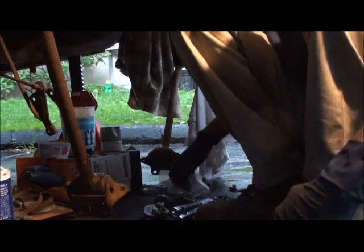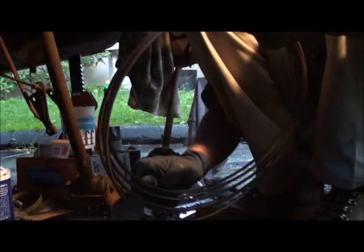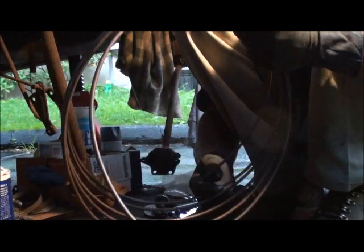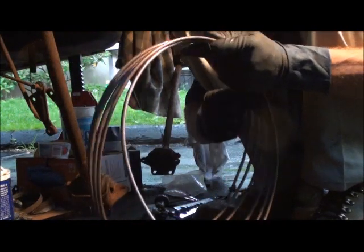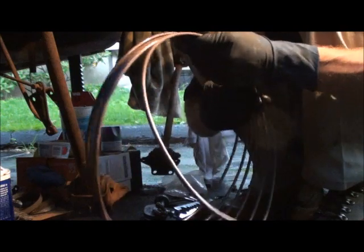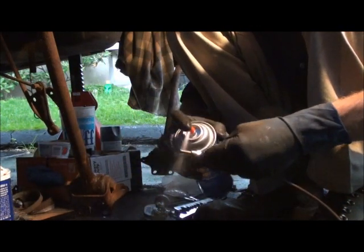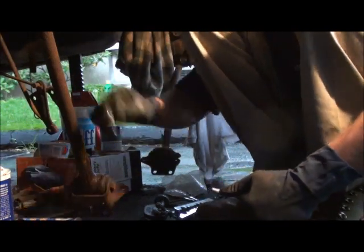Take your fitting. You're supposed to put your fitting on before you flare the brake line, but if you got a spool, you can just make the fitting go round and round on the spool like I'm doing to get the fitting at the right location. This is just regular 3/16 brake line, but it's not the normal 3/16 brake line. It's copper nickel. Take some brake fluid, some carb cleaner, clean it off. Okay,